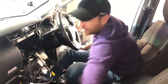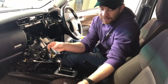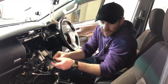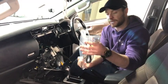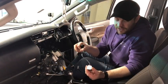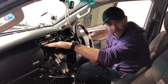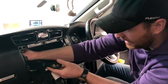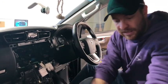We're going to show you how to change the brackets real quick, and there are a couple of little extra things to do. We do have to run a new external microphone, which comes in the bag. We're going to run that up to the center portion of the A-pillar. We're also going to run an extra USB into the glove box. There's a GPS antenna receiver which we can bounce up straight away — just stick it on the inside of the dash on a metal section on the left-hand side; it'll still get reception because there's a clear line of sight to the sky.